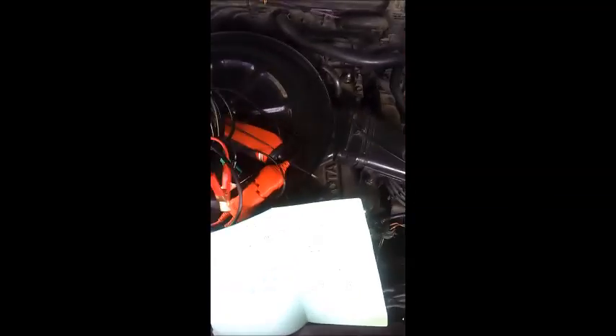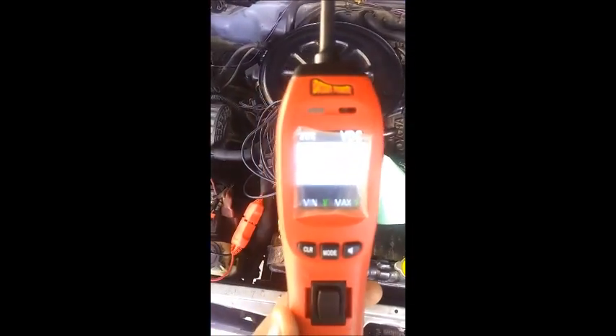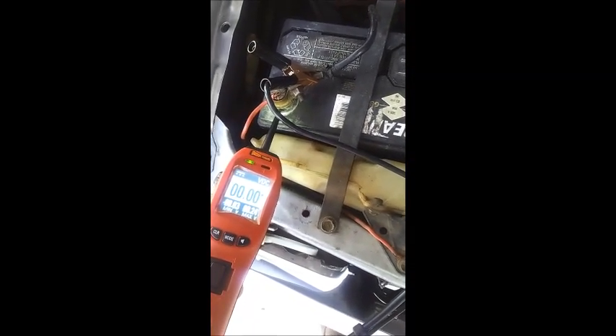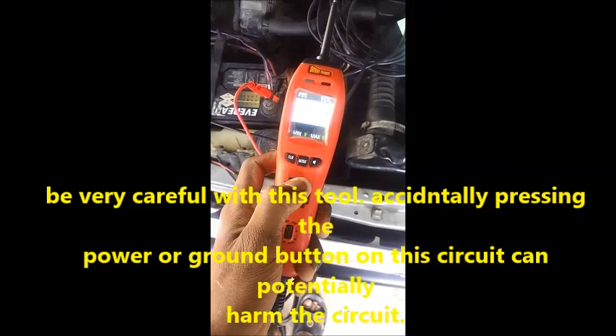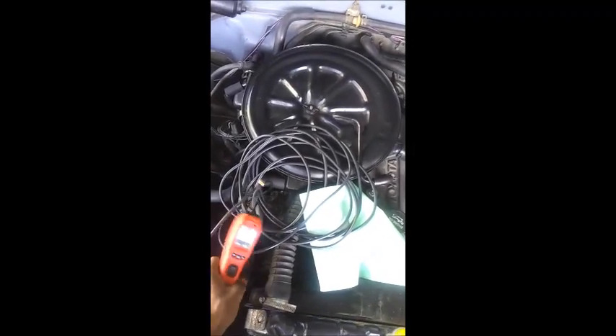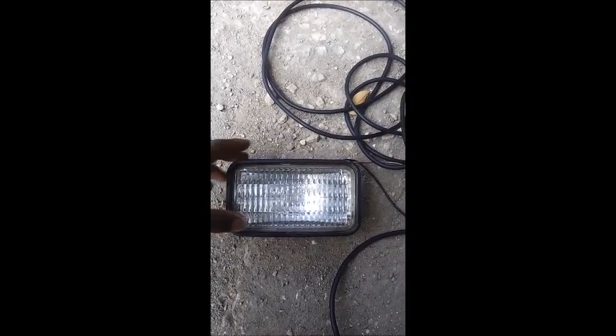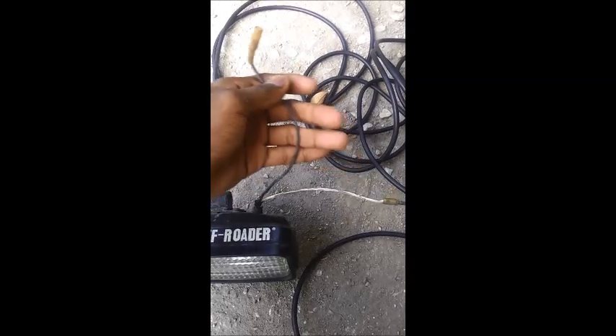Let's connect up the power plug. The screen is huge - shows you better voltage sense and power. I'm gonna do a test right here and show you how this thing can really be a time saver. Here we have a fog lamp right here. I just want to show you how you can use the power probe to test a load very quickly. Here are the two wires - one is ground and this one is the power.